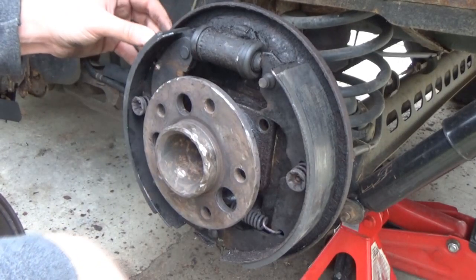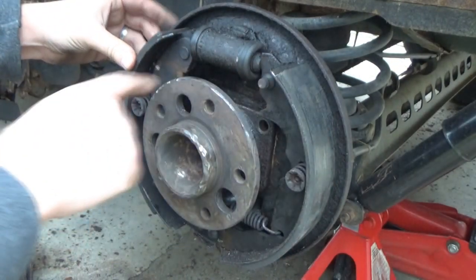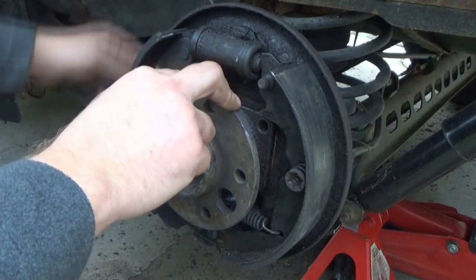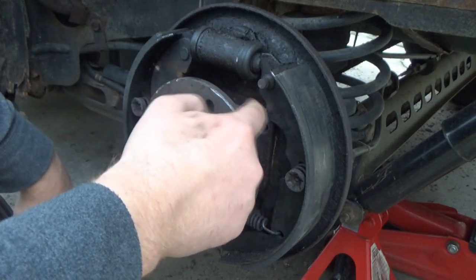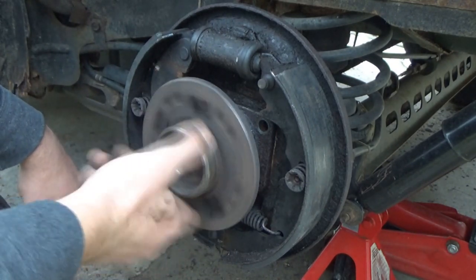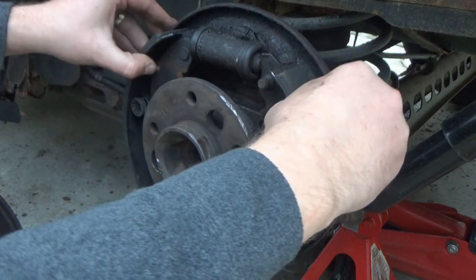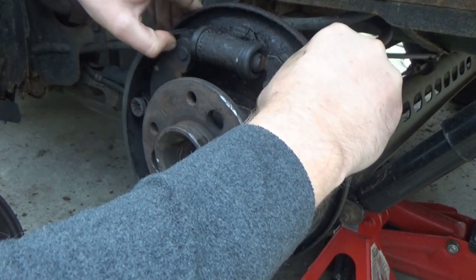What I was going to do is tear the brakes apart. I started removing a couple of the top components: the spring that goes across the top, the parking brake adjuster, and the little thing that turns the adjuster. I was going to take all this off anyway to change the wheel cylinder, but I might not have to — I might be able to carefully wedge the shoes out once I get the new one in.